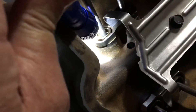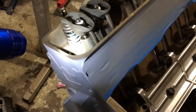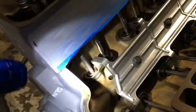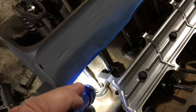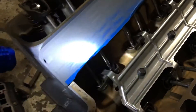Once you tighten it one turn, the pressure from this big spring will force that plunger down against the oil pressure inside. It should push that plunger down - maybe a few thousandths of an inch. Basically what I'm saying is that the valve drops at first, but if you give it about a minute, that valve spring will overpower the lifter and push that plunger down. So after a minute, the spring will have pushed the plunger down through half its travel, and that's your valve adjustment.